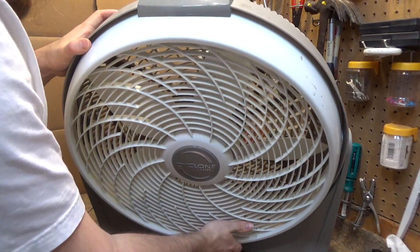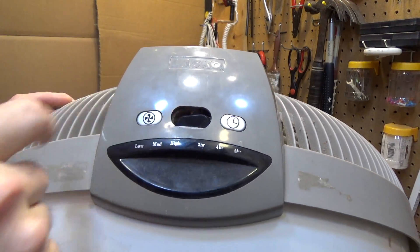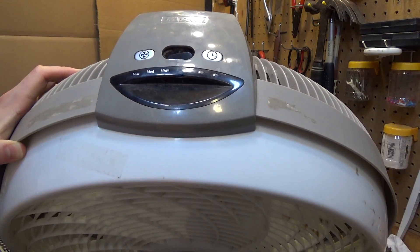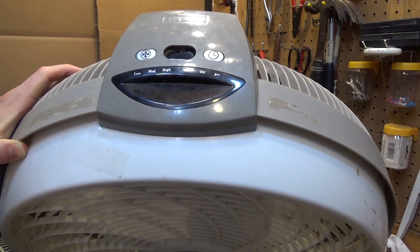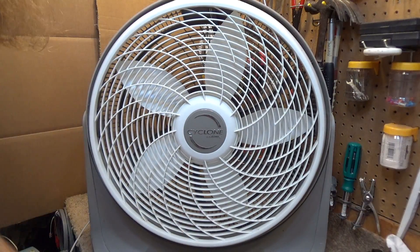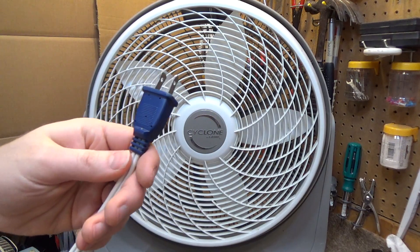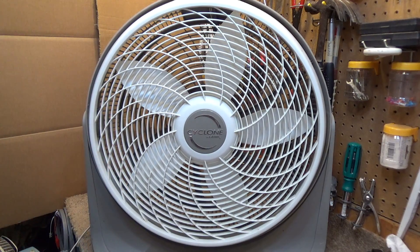Now there is something wrong with the top of it. I believe this is just an IR receiver - I think these would have had a remote. The buttons themselves appear to operate, although it's very possible the electronic control panel just failed, because I don't give those a lot of credit for reliability. There is also the possibility that the fuse in the plug has gone bad.